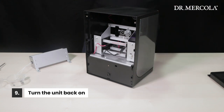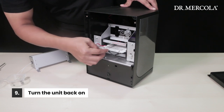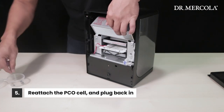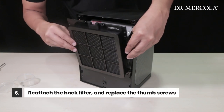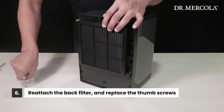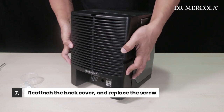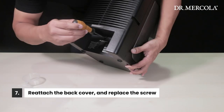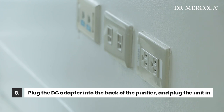Next, install the purification plate in the back of the unit. Hold the white framed edge of the plate and gently slide it into its designated slot until it is completely in place and the metal clips are contacting both sides of the plate's wire mesh. Then install the PCO cell — gently slide it into place, replace the nuts that hold it, and plug its connectors back in. Install the back filter back onto the purifier by inserting the bottom into the supports and then closing it up against the unit. Replace the two thumb screws that hold it in place. Position the back cover to the back of the unit, tilt it so the top will make contact with the back of the purifier first, and insert the top tab into the space above the back filter. Then tilt the back cover down until it's set in place and replace the screw in the back cover.